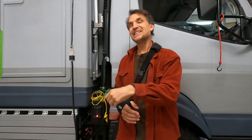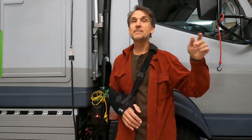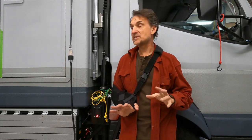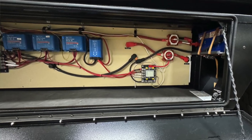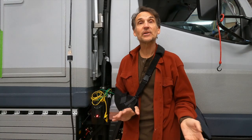All three shore power connections also provide an auxiliary power output to the starter battery, keeping it trickle-charged — really key so I can come back and start the vehicle with confidence. The solar on the roof also charges the house batteries, which subsequently trickle-charges the starter battery too. I have dual DC-DC converters going from 24 volt to 12 volt, so if needed I can charge the starter battery at a higher rate from the house batteries, or leverage the house batteries to support heavy winching operations.